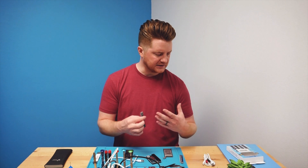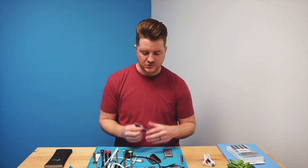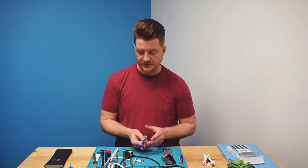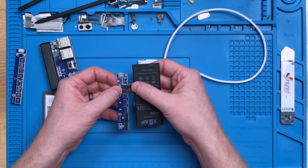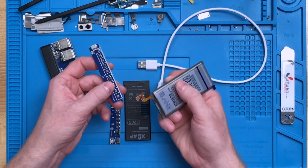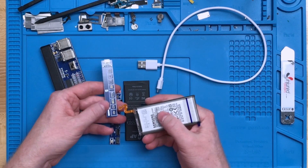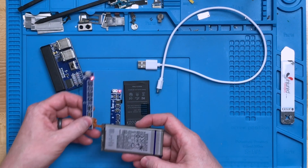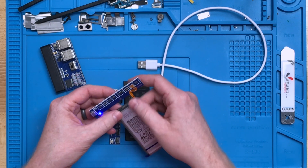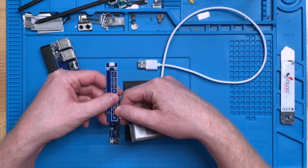The previous one didn't come from Injured Gadgets and it looks a little different. This version has iPhone 8s, XS, XS Max, 11, 11 Pro Max, and newer device models, so I think they've updated it. Whenever you plug a battery in, it always seems like the battery has to come off the same side as the connectors. For an iPhone board, you'll have the battery upside down plugged into the 7 and 7 Plus connector and you'll see a red light. Galaxy batteries are reversible, but the proper way is battery hanging off the side closest to the connector — that gives you the correct red light. If you reverse the polarity, you'll get a blue light, and on our previous charger that caused smoke, so red lights are how it's supposed to work.